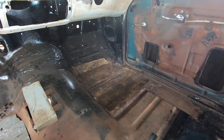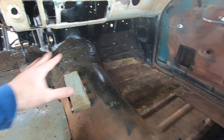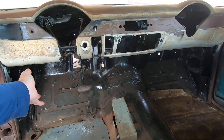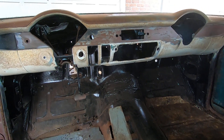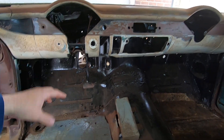I'm about tired of this rain — it's killing me, I can't get anything done. Now that everything's out of the car I can show you the floors. Back here is all great, but I had already taken all the dash parts out, removed the firewall pad, cleaned everything up, sanded it all down, and used POR-15 even behind the dash. All that is pretty much clean up there, but I didn't do the front area because I have to replace somebody's handiwork.